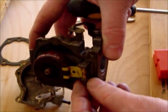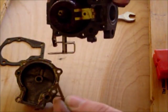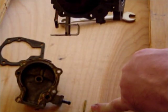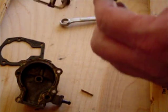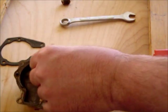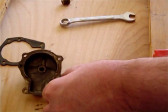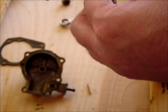I would keep this little pin that we remove from the back here. Some of the aftermarket kits — that little pin is actually a little bit longer, and it creates a problem when trying to put the bowl back in because it's a little too wide and it doesn't allow the back here to slide on. So I would always keep the original parts until you're finished with the cleaning and repair.